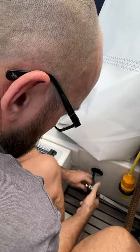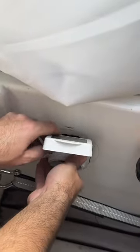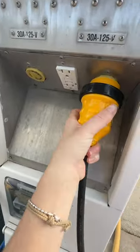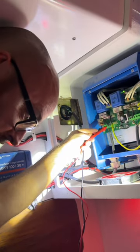First, we removed the old plug, got a shot of Mads through this little hole, rewired the new 115 plug, and did a little test fit. Next, we plugged into shore power to make sure it was working, and Mads used the multimeter to check we had power. And we did, so looking good so far.